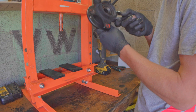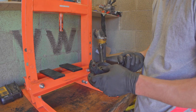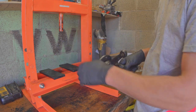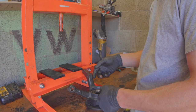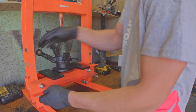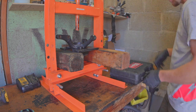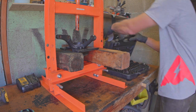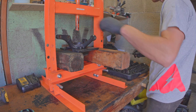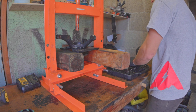The bearing, because the snap ring is on this side, has to come in and out from the rear because that's where the snap ring is — you can't push it out the front. We've got to press the spindle out first, which pretty much means we've got to set up to catch right here. A brief aside: it's perfectly valid — and this is what I did last time — to take your knuckle off yourself and then just give this to a machine shop. Most machine shops and local mechanics will have a press, and you can just avoid this part by making someone else do it. Usually it costs like $50 a side.